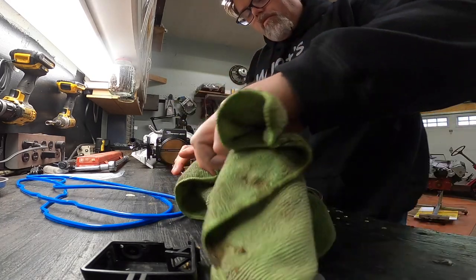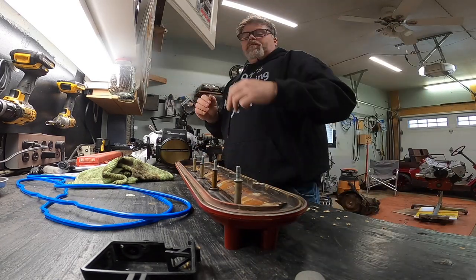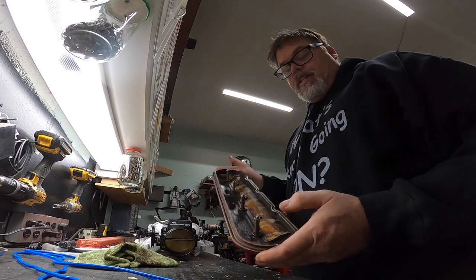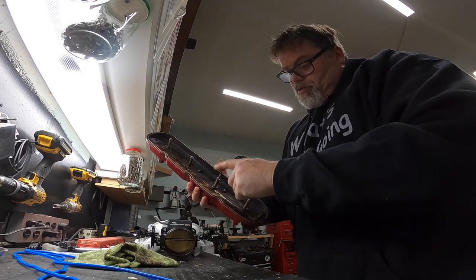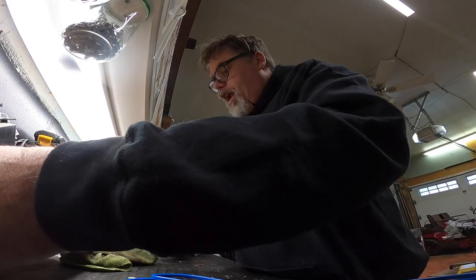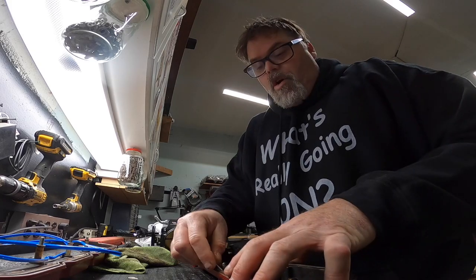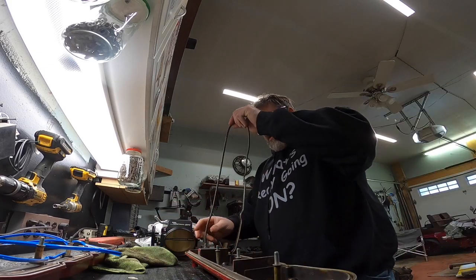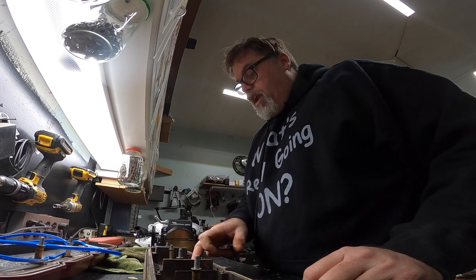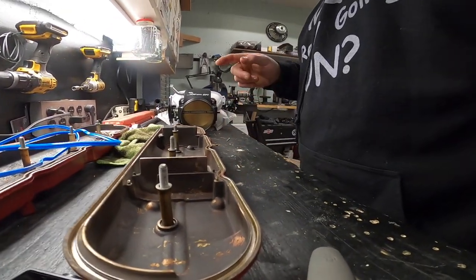We'll wipe her down a little bit and see what's what. I'm gonna have to get some brake clean — can't even put these on today. Here I thought we were gonna put these on today, but I gotta brake clean them because I sandblasted these and there's gonna be fine sandblast particles all throughout that oil. I'm gonna have to spray this out and clean it up before I put them on. But we can put the oil pan on. That gasket's still good but we're putting new ones on anyway — this one is actually pretty clean, but we're still gonna brake clean it.